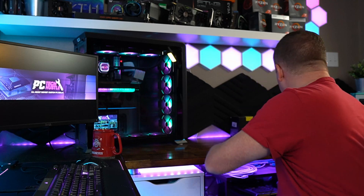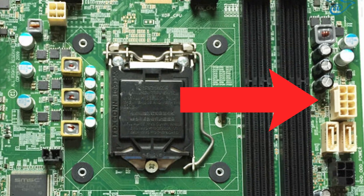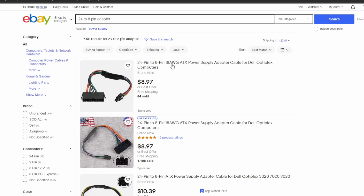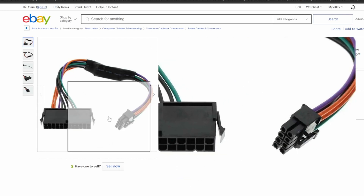Let me grab a power supply. With this power supply here, we've got your standard motherboard ATX 24-pin. With a normal aftermarket PC build using an ASUS or Gigabyte motherboard, they require 24-pin power. But with these Dell Optiplexes — the 9020s and similar — they require an 8-pin power motherboard connection. So we need to buy a part that adapts a 24-pin from your standard ATX power supply so that we can power the motherboard. These are pretty simple parts, usually about $8 to $10. The top result here has 64 sold — I've used these before in other Dell Optiplex videos and they're reliable. Motherboard power for Dell Optiplexes doesn't pull a lot of power anyway.